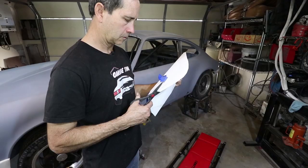I mentioned last week that this was overlapping, which it was. That little hammer and dolly work on this particular weld right here doesn't look like it would do much, but it absolutely stretched this to where it's no longer overlapping, and now I can continue welding around the edge. This is a little bit offset, but as I go it will get better and better. I've taped a little handle onto this thing and I can get it to fit pretty tightly up here towards the front. The corner's not lining up very well in the back, but I just need to kind of bend it in place. I'll tack weld it here towards the front, continue on this upper corner at the seam of the factory panel, and then tack this thing in and start pushing it into place.